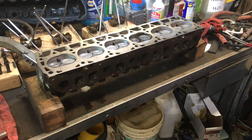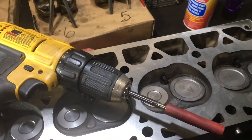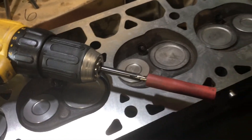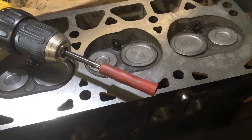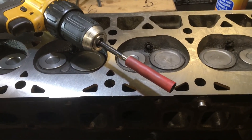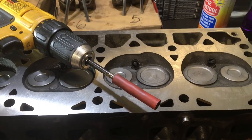This happens while engines are running and you'll get an intermittent miss — it's from the carbon that builds up inside the combustion chamber or the valve chambers. In this particular instance, where we didn't want to put a lot of money into an engine we're not sure is good, this little homemade device lapped the valves in a couple of hours without having to have a valve job. If the engine runs and doesn't burn oil in about a thousand miles, then we know the engine was okay. This is a way to do a valve job like we did back in the 40s, 50s, 60s — not a preferred way, but it is a way to cut corners.